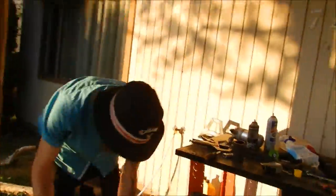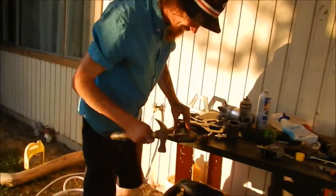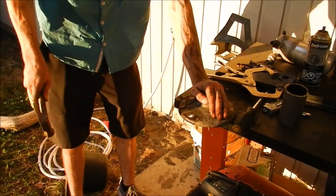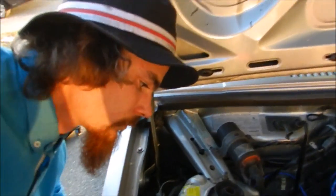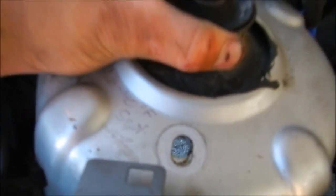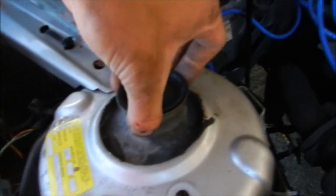The top hat is out. So this is the way it was originally — there's more space between one stud and the center than the other, so this goes at the back. What we're going to do is bang this stud out. We put it on the workbench and smack the stud out — it's just held in with a spline. Scott's going to do that with some penetrating lubricant to lube things up, and a good smack should get it out. So we're taking this top hat and sliding it inwards to the maximum position where the center piece is touching the body of the top strut mount.